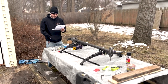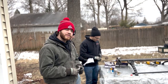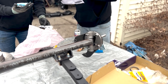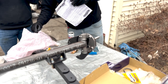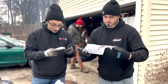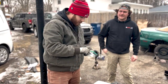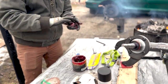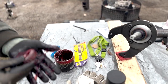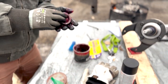On the spindles, we're going to put the bearings on. But before we do the bearings, we have to pack the bearings full of grease. He's grabbing some bags so I can use my hand to pack the bearings. You have to scoop it in and make sure that it's coated everywhere possible. You've got to load the inner wheel bearing with grease.